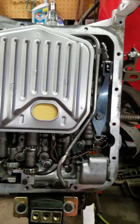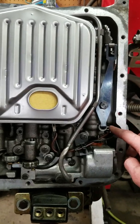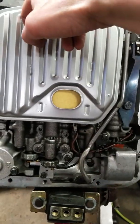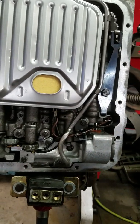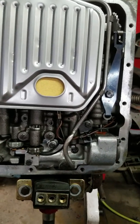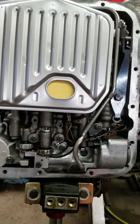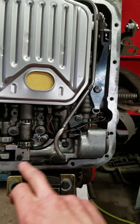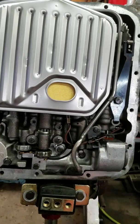But the simple way that 90% of people do it is: just a main power wire coming in going to the lock-up solenoid that runs through your brake switch. I like to run an on-off switch so you can turn lock-up on when you want out on the highway and shut it off when you're cruising around town. And then the other side of it goes to the fourth gear pressure switch — that grounds it, and you're done.